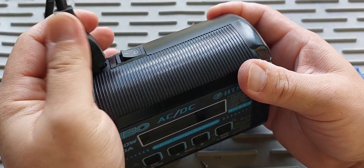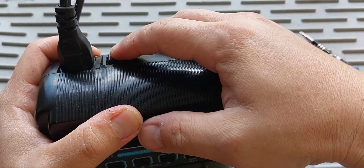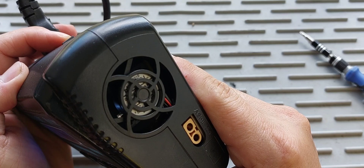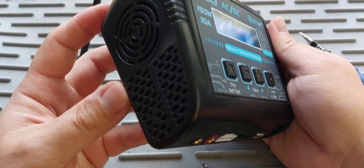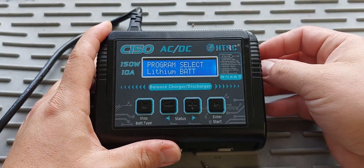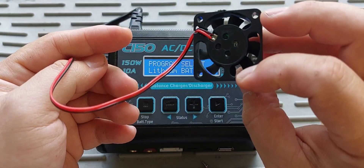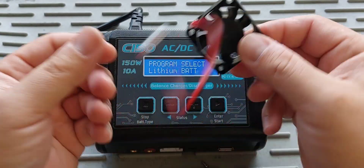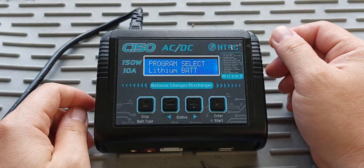This unit has been working great — it's a knockoff, not a name brand. The noise from the fan was only happening in colder temperatures, not hot. Let's see if it works. It's a little bit quieter. Thanks for joining me today — just a quick video. If you're having this issue with your charger or the fan making a bunch of noise, that is the problem: the grease has left the unit. This fan I bought online was roughly about five or six bucks shipped to the house. Not too bad. I'll see you in the next one, take care.